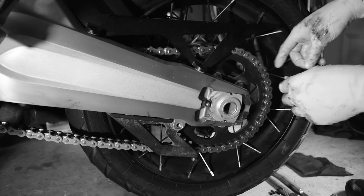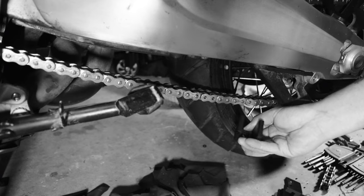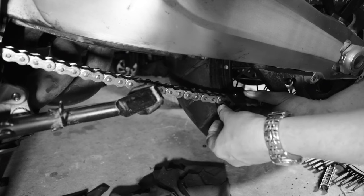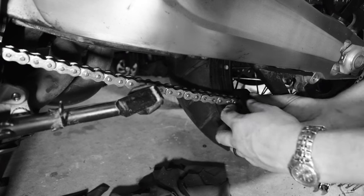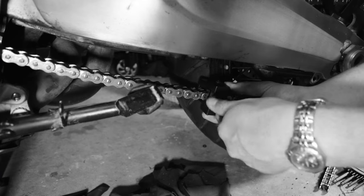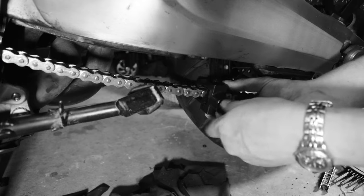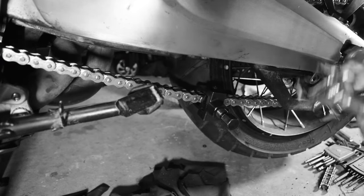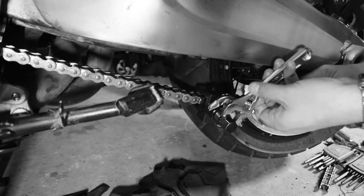I like how the KM500 tool is very easy to use and prevents overdoing each step. For instance the face plate press — you press it until it bottoms out. The chain was still very fluid and didn't have any binding. I then press the rivets and again the KM500 makes this a simple task. You apply the rivet until the face of the rivet portion touches the face plate. I found that the KM500 was not as easy to line up on the link pins though as the Motion Pro tool. However, if you have to rivet your master links the Motion Pro tool isn't going to do you much good.